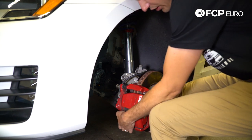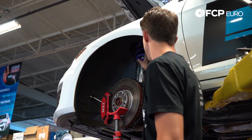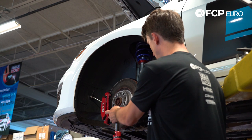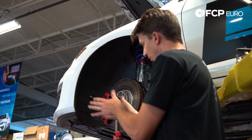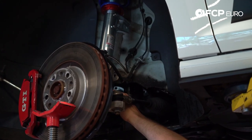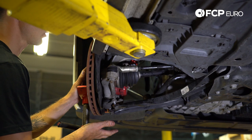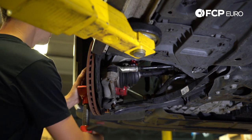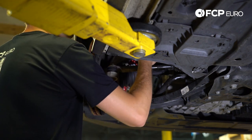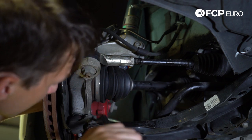The best way to move it is to wiggle the rotor top to bottom. We bolted the strut in at the top and then set it into the knuckle as far as we could. With the transmission jack under here and the bottom ball joints reattached to keep this from spreading out, we use the transmission jack to put tension on the strut while spreading the joint — we were able to seat the strut all the way down to the knuckle. Now we put the pinch bolt back in — triple square from that side through, then 18mm. Then we use a pry bar to seat the ball joint all the way.